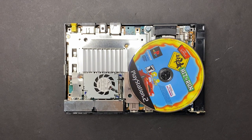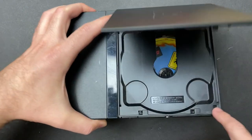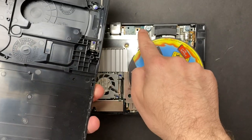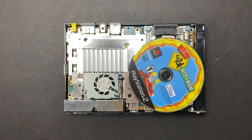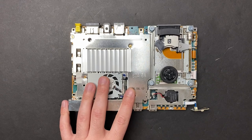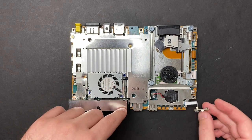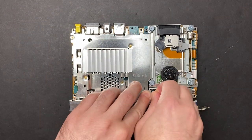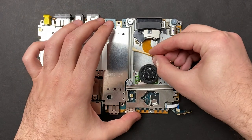If you did not want to remove your warranty sticker, you want to spray some contact cleaner or at the very minimum some rubbing alcohol on the door sensor — the front one and the one in the back. With the case on, you kind of have to shower this little hole. It's actually the latch that depresses the button, so you have to shower some contact cleaner or rubbing alcohol back there and just work the door up and down. I'm not going to do a full teardown on this unit, but I will take off and clean the fan, grease the rails, clean the laser, and check the save battery. I've also removed some footage of general dusting and cleaning — I'm going to focus on the more important maintenance stuff.